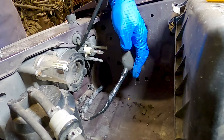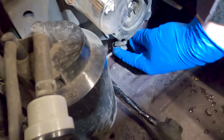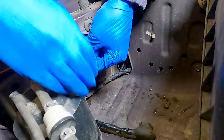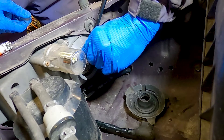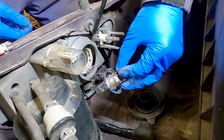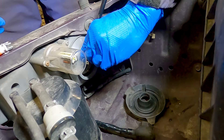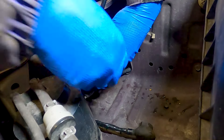Here's a glimpse at what the final product will look like, but first we need to put that tab back in down below that holds the wiring in place. A lot of vehicles have options that are never installed and sometimes you'll find connectors that are just unplugged from factory. Before this headlight will work again, I need to replace the bulb that was badly burnt up — it's super easy to replace on these cars, and this bulb was literally missing a tab that burnt off. It's always a good idea to check if a component has been damaged by faulty wiring. Once the new bulb is in, it's almost time to test if everything is working.